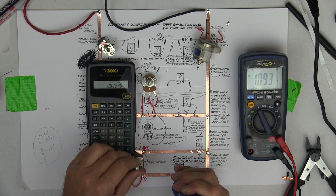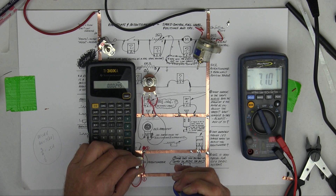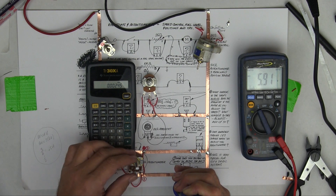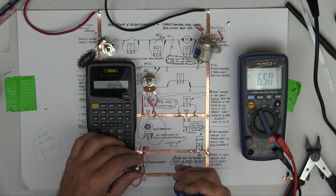I'm going to run it down to 6 and a quarter volts, and in doing that I'm setting the position. What I want to prove to you is that corrosion can kick your butt with these sensors, and it's wiring. Everyone wants to change the sensor - check the wires first. You can do it by simply reading voltage.